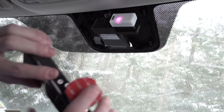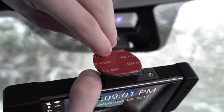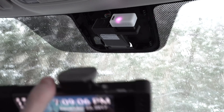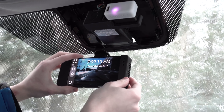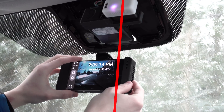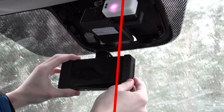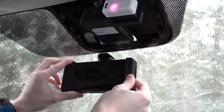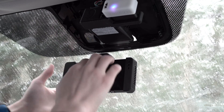Now it's time to mount the EON on the dashboard. To do this, I attached the GoPro mount already to the EON, and then removed the sticker that blocked the adhesive. Now it's time to line up the EON with the existing lane keep assist camera vertically, so the camera on the EON is in the same Y axis as the camera from the existing system. This is what makes calibration the best and is what's recommended. So I put the EON a little bit below the rearview mirror mount, where I could stick the GoPro mount on the glass, and then pressed that into place.